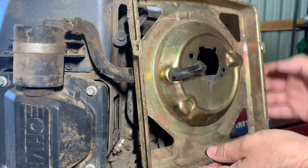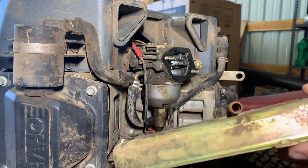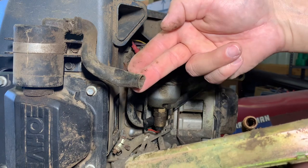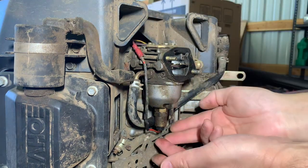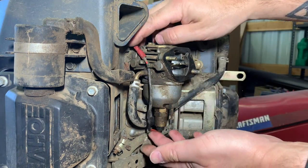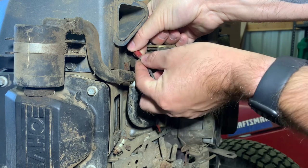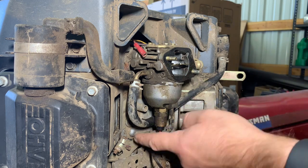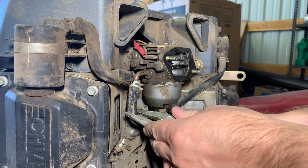Don't lose your gasket. That just has a little tube back here attached to that guy that was kind of pinched. Here's our fuel or carburetor solenoid that shuts the fuel off when the key is not turned. Just unplug from here and that'll dangle down there. We've got our fuel line right here, so I will take a little vise grips just in case. Pinch that off.